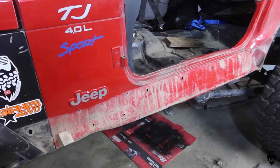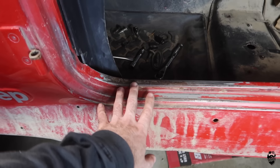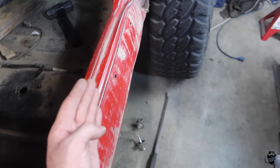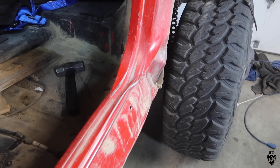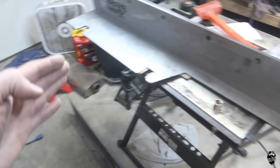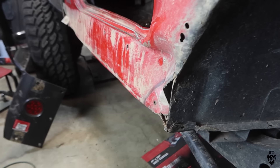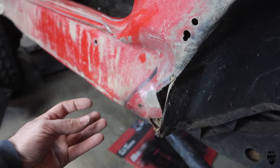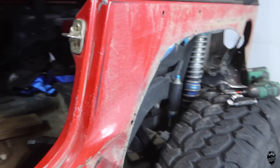I got this side apart. You can see it's smashed up here. This is pinched right here, so this whole door sill is pushed in a little bit in the front. It's kind of angled in towards the cab and gets worse further back. The most important thing to me is pushing the sill back out so it's more flat, so my door opens and closes. This bad part here — it's in a good four inches in this corner because the edge of the rock hit right there, and I might end up cutting some of this out because I can't get to it from the inside.